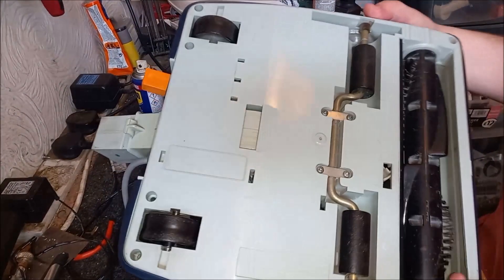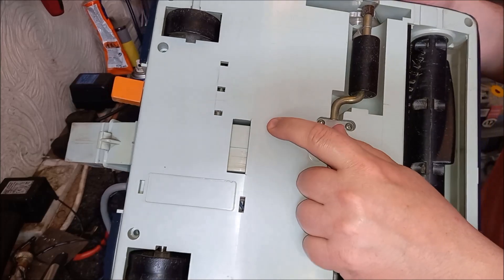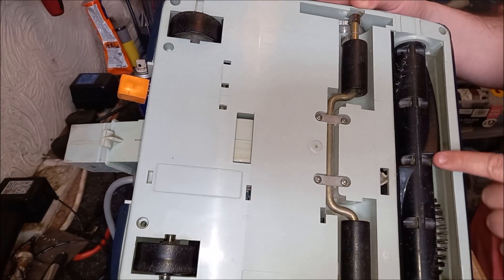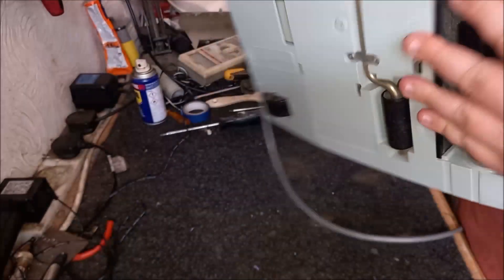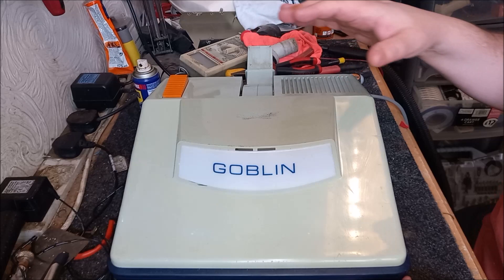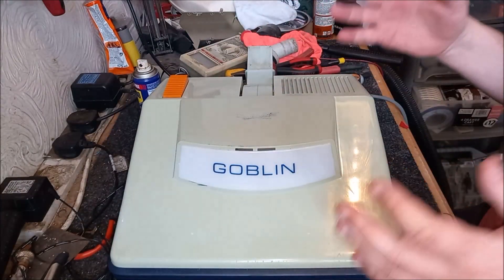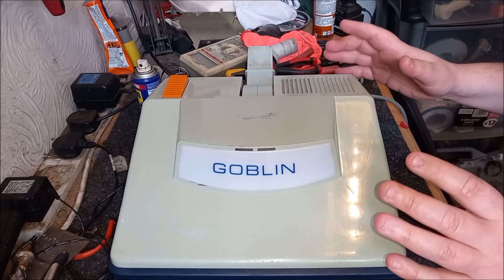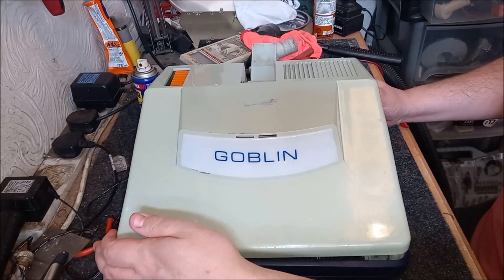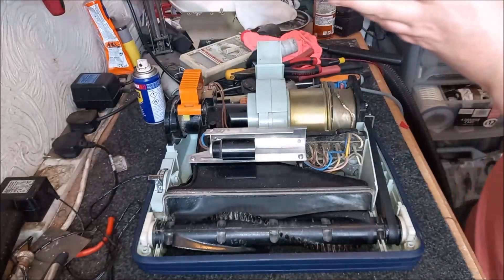That's our four screws removed. You can see here that the chassis is cracked and I suspect that is why the machine's leaning forward — we're going to have to try and repair that. The rest of the base is pretty good, so that's a positive. Now I'm going to take this hood off, and bearing in mind that the end user had to do this in order to change the belt — there's no other way to change the belt on the Housemaid apart from removing the entire hood. Let's wiggle this off; it hasn't been off for a long, long time. And there we go — we're inside.